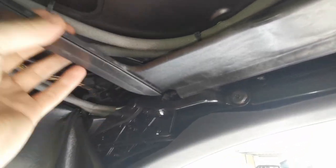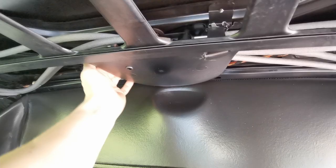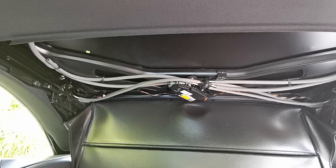We might have to actually move the roof to get to the rear bolts in that corner. I need to figure out which bolt is which. This panel needs to come out — the tray is missing on this one, so the previous owner just broke that off on the old roof. This needs to come out, and then we should have this plastic piece out of the way, which may or may not be holding the motor — nope, the motor's screwed to the roof. Which means we need to actually remove it from the roof.